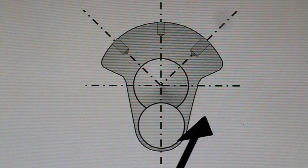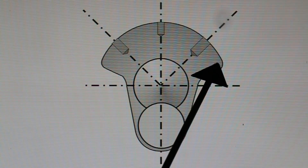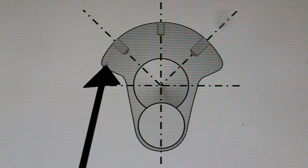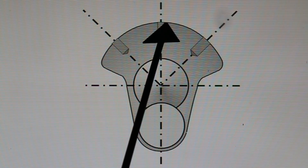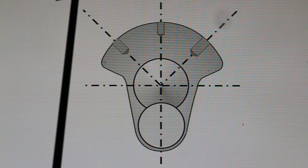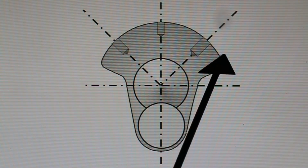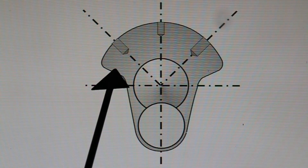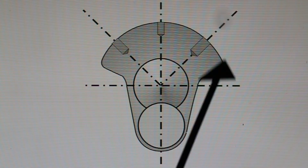We've got two things to combat: the weight of the crank and its windage. If the crank is way out of balance, one of the first things you can do is turn the OD of the crank so that it is smaller — that gets rid of a lot of weight in itself. The only weight that's 100% effective in offsetting the out of balance here will be here; everything else gets less effective. When it's over here, 10 grams removed from about here and here has about the same effect as 2 grams removed from there. What we want to do then is balance our crankshaft with the preferred metal removal as shown in the next diagram.